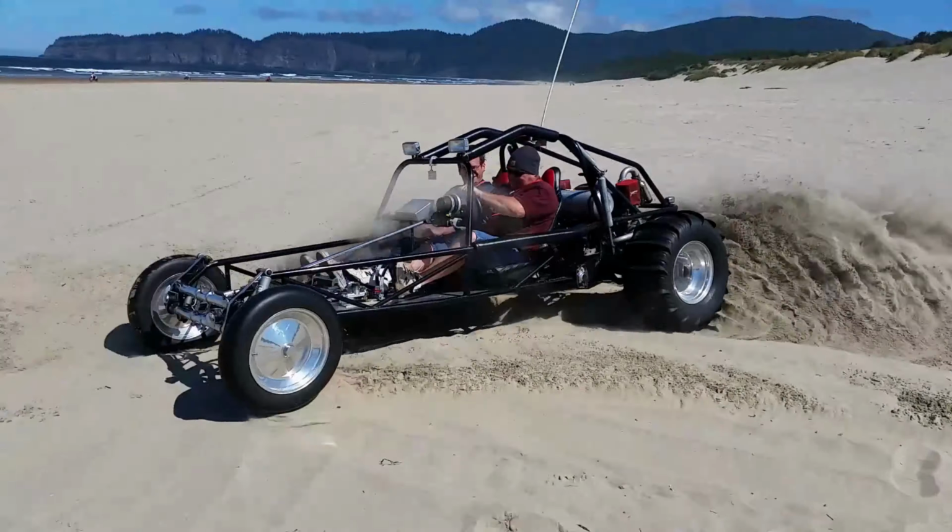Getting ready to bleed those brakes, and I looked in there, and the brake return spring is actually broken. So that meant I had to pull the whole pedal box out, and all the grease was like clay. And I'm gonna put these on here too. This is something that comes from Renline, and I have one for the clutch and the brake.